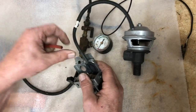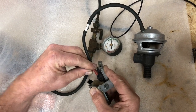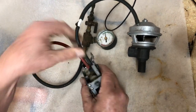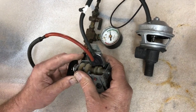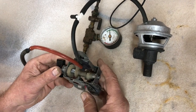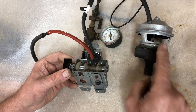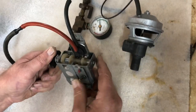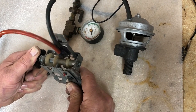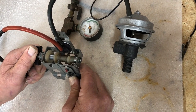Now we're going to turn it over and go to the other valve vacuum supply on the top, which could go to the air conditioning, the hot water valve — we don't know. Operating its cam in the right direction, it has lifted the valve — yes, you can see the valve is going up, actually a little bit further than the other. Turning it down and look, the valve goes down a little bit. Turning it down more and the valve goes down further. So again it is doing its job of varying the height of the pintle in the valve by design.